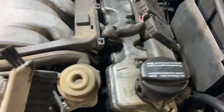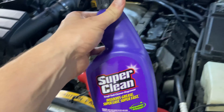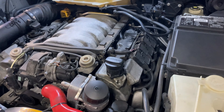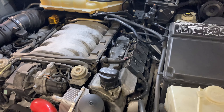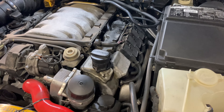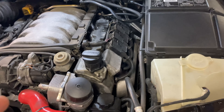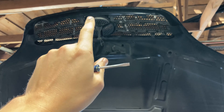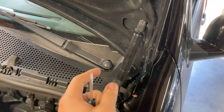My plan of attack: I'm going to start by scrubbing this down with a plastic bristle brush to loosen up the big stuff on top. Once I get the coil packs cleared out, I'll hit it with some degreaser, spritz it with water, then vacuum or blow it out with compressed air. Not going crazy full degreaser mode — just clean enough to not worry about anything falling into the heads and to see what's going on.